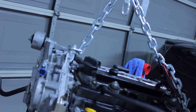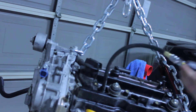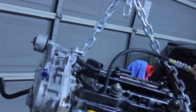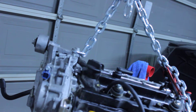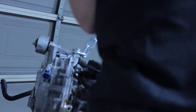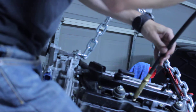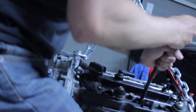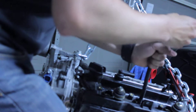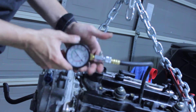I'm at 170 PSI on that one. I'm going to go over this video and those numbers again. According to the factory service manual from Nissan, if there's a difference of 14 PSI or more, you definitely want to rebuild. Just so you can see — it's starting at zero.